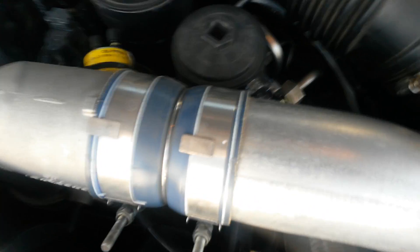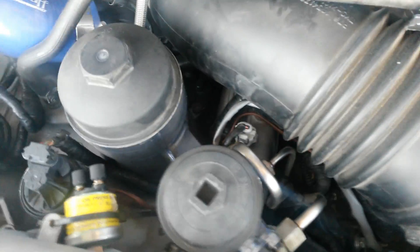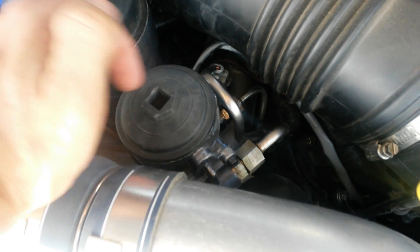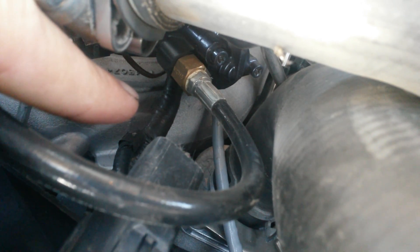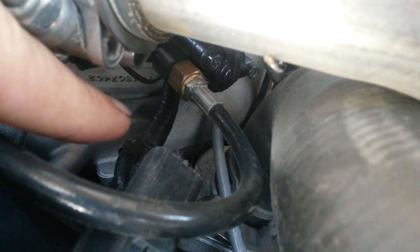This is going to be an in-depth look at how you can do a really inexpensive fuel pressure gauge on a Ford 6.0L diesel. Basically what you got here, this is your fuel bowl — this is where your secondary fuel filter is. And right on the side there, you've got a dummy plug. You're just going to tee in there with a little adapter. You can get those adapters on Amazon in a kit for under $10. I'll put a link down in the description so you can get that kit.